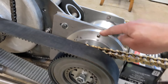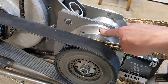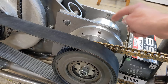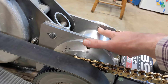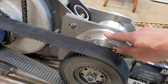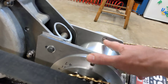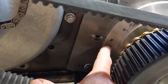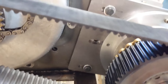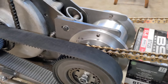Everything's absolutely bolted up. These bolts are only quarter-inch between the gearbox and the plates themselves, so the gearbox had to be drilled as well as the plates. What we plan to do is open these holes out to 3/8 and then tap the plates UNF. UNF is a really nice thread compared to metric, and then the bolt will just go into the plate without needing a nut on the back. We don't have any 3/8 UNF bolts at the moment, so we didn't want to do that operation yet as we wouldn't be able to bolt it all together. The current bolts are on the small side for handling the torque, but they will be thicker in future.